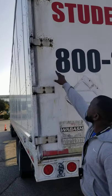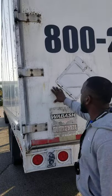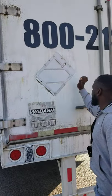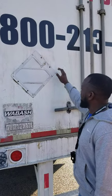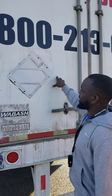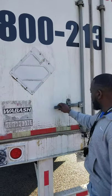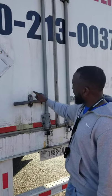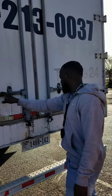We have our door hinges. Door hinges are not missing any nuts, bolts or screws, not been broke or cracked, and properly mounted and secure. We have our door. The door has no holes, dents or illegal welding, not bent, broke or cracked, not missing any nuts, bolts and screws, and properly mounted and secure. We have our door handle. The door handle is in the locked or secure position, not missing nuts, bolts and screws, not bent, broke or cracked, and properly mounted and secure.